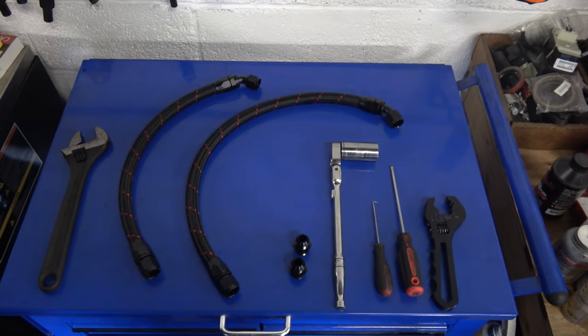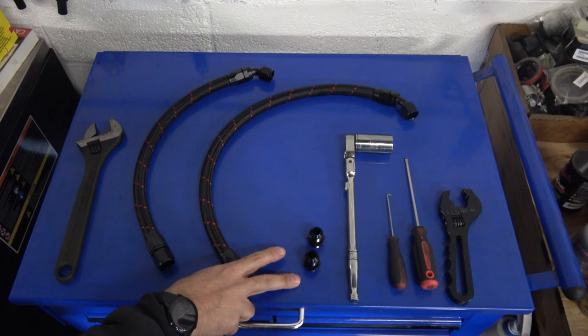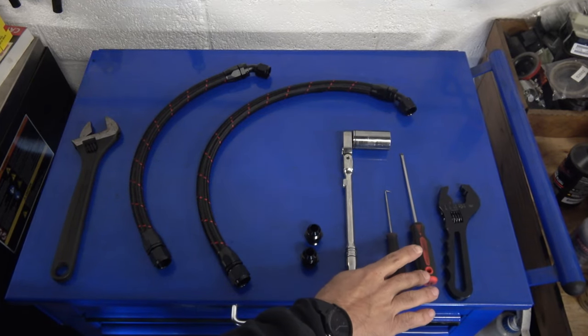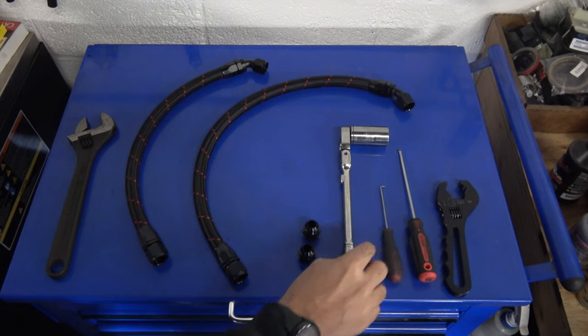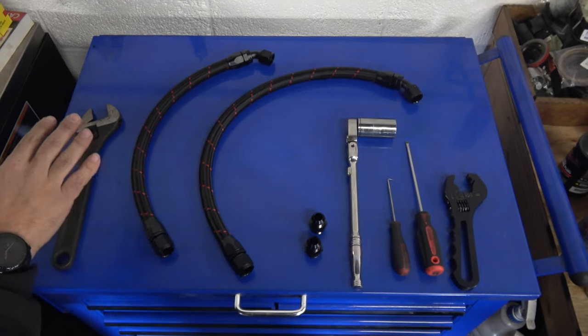This is going to show you how to install our preassembled kit on the truck. Here's everything that you're going to need to complete the job. I only show two of the oil cooler fittings right now, because the two that go into the block and the timing cover are already installed. Your upgraded oil cooler lines — to take the old lines off, you'll need a flathead screwdriver to pull the black cap off and then use the pick to pull the clip out, and the line will come out of the fitting.